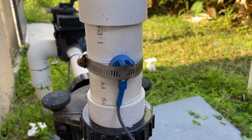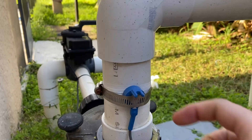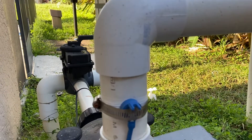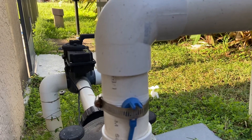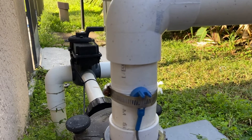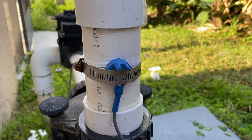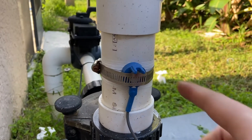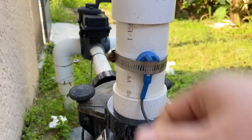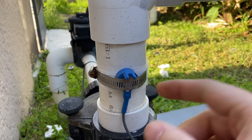Because of that deformation, I was having a really hard time putting the thermostat back on and sealing it so it wouldn't leak. Water was just shooting out of each one of the joints, and no matter what I did, water kept escaping. So what I did was get some Teflon tape and wrapped it around over and over.